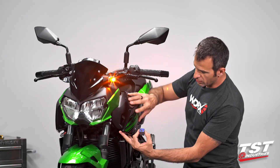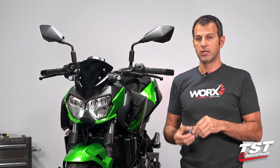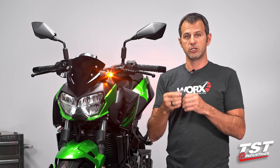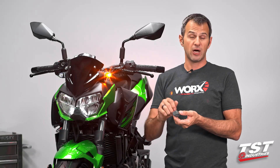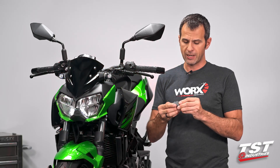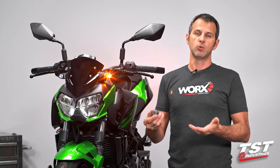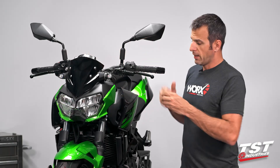The OEM component lives under this panel. In just a minute I will show you how to change your OEM signal relay to this relay. One thing I want to touch on before we start the installation: this is an adjustable component. If you slip this gray cover off, you can fine-tune the flash rate if you choose to go away from the 85 cycle per minute rate. I'll also show you how to adjust the flash rate. Let's power down and start wrenching.